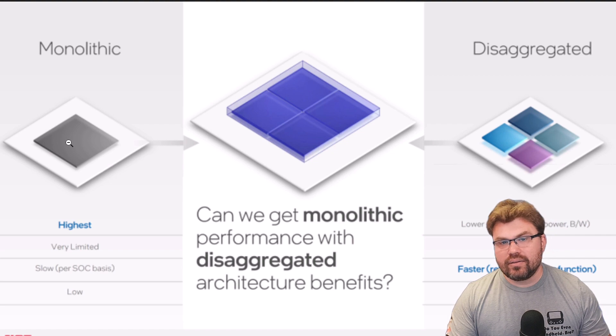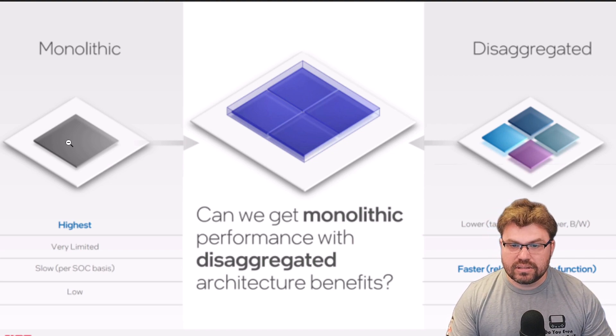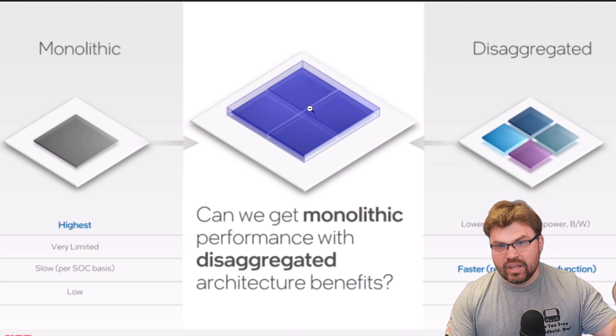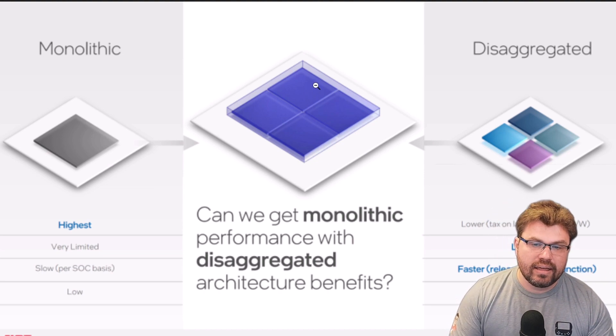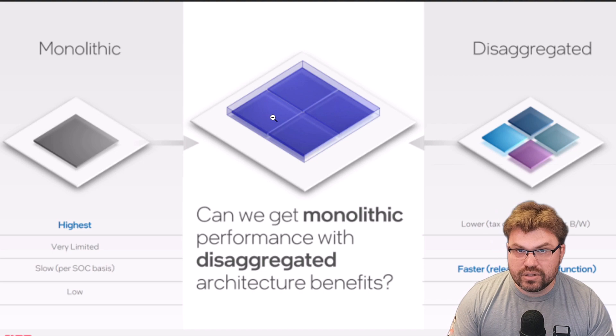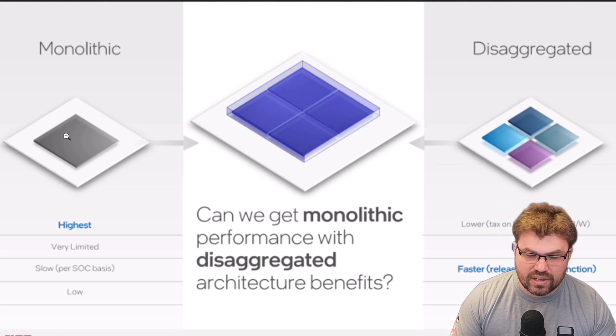The 8850U is going to be monolithic in design, so it's a single package that contains the whole chip itself, versus something like a chiplet package, which uses bits and pieces from other parts put on top of a substrate to create a cohesive whole. That is what other types of AMD desktop chips use, but every chip we've ever worked with on a handheld has been monolithic by design.